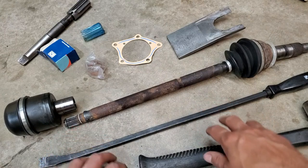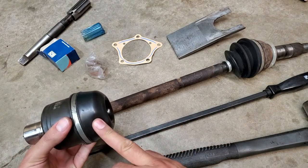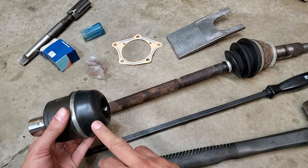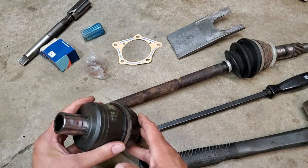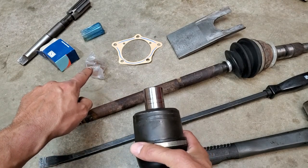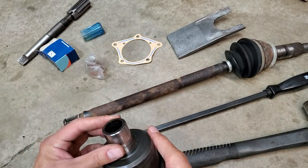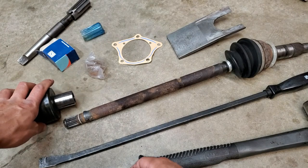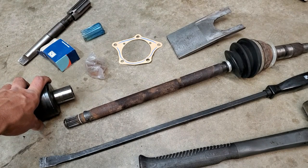I think that's all I have for this supplemental episode. If it helped you let me know. When I first started out I didn't realize you could change these boots with the axles in the car — I just assumed you had to pull the whole axle assembly apart. I also didn't know about the bearing when I first started doing Mini stuff, so I used to change these out and the joints would be really tight and it was always a battle getting it back together. If that helped let me know in the comments below, and as always thanks for watching — I'll see you in another episode of tuning, parts repair, or something interesting.